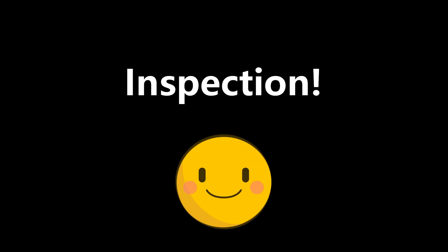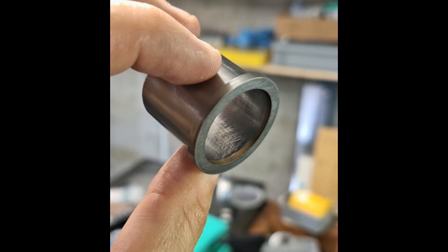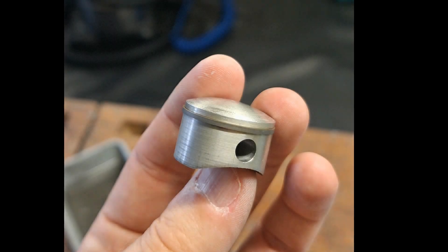But before we do that, we take the opportunity to have a look at the piston, cylinder liner, and rotary valve after around one hour of run. Will we see wear and abrasion marks? The cylinder liner looks still outstanding — the honing marks are clearly present and the burn marks in the combustion chamber area are very visible. There is no visible burn-off in the working area of the piston. The piston is also in very good condition, with no signs of damage or burn marks on the piston skirt, and no marks or grooves on the sealing surfaces of the piston ring.